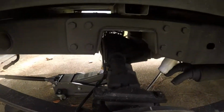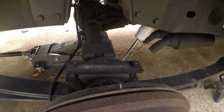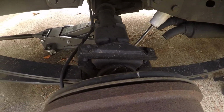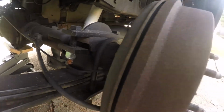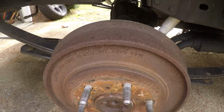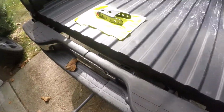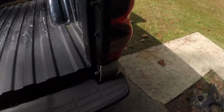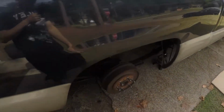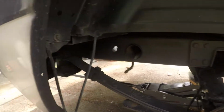In my last couple videos, I had installed a 4.6 drop kit on this Silverado. So we had to C-notch the frame on both sides, and we got our hardware bolted up. But today's main goal is to put some drop shackles on the rear. Pretty much all the research that I did on these trucks, when people were lowering them, they said that you'd have to lower the rear even further, basically to make it level. So that's what we're doing today.